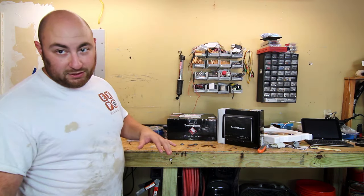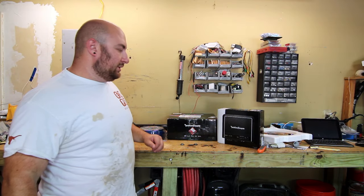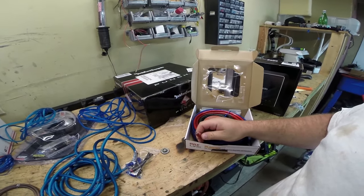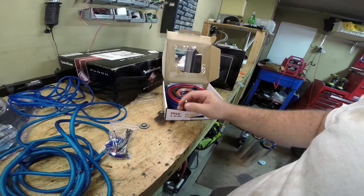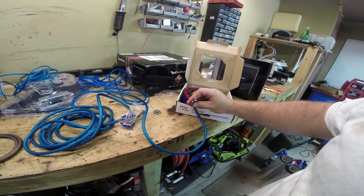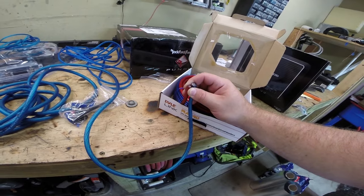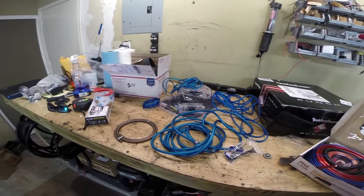The part we're going to focus on today is wiring this to the battery and wiring the amplifier turn-on to the ignition. Here's a cheap Pyle or Boss standard Chinese-issue 4-gauge quote-on-quote amplifier wiring kit I happen to have in the garage. Take a look at the amount of copper in this versus the SoundQuest kit. They're about the same outside diameter, but you can clearly tell this is an 8-gauge wire wrapped in 4-gauge worth of protection. The SoundQuest is a true soft flexible 4-gauge wire — that's why we're using it.